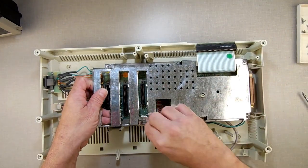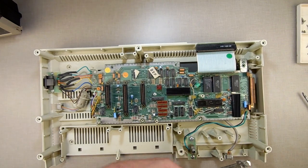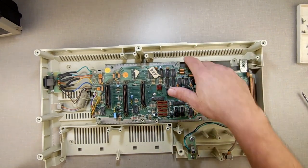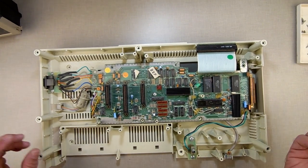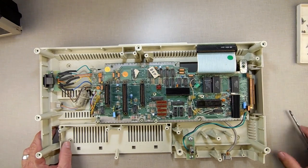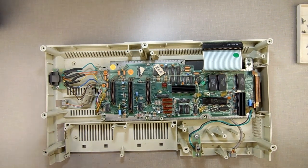Take your RF shield, lift it up, get your screws if they're loose, and guide it out through the hole. One of the fun parts about taking your Adam apart is you get to see all the little stickers they put in saying 'yeah we checked it' and the wires they patched in. There's a screw back here too — don't forget that one. I'll keep stressing this: you don't need the RF shields at all. It doesn't affect operation of the Adam — it only affects AM radio reception nearby.